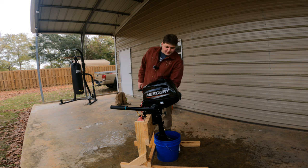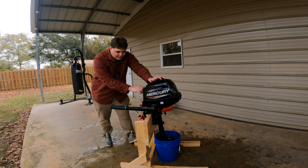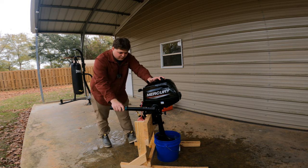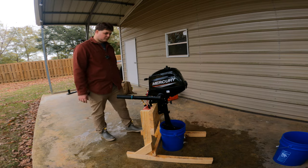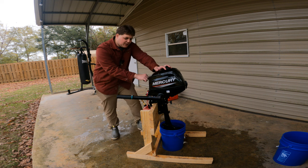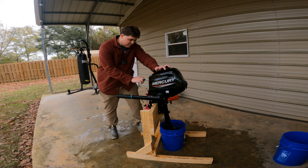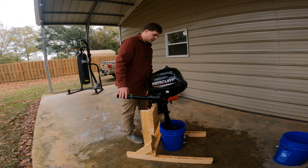I'm going to shut my fuel off — it's just about brimmed to the top — then restart it and let it die. The engine finally stopped. Keeping it in the start position while it's hot, I'll give it a couple more cranks. You can see it sputtered a couple times, just getting the last bit of fuel out. That carb is completely empty — this thing is ready to be stored for however long you need.